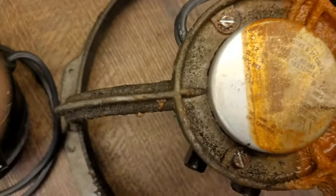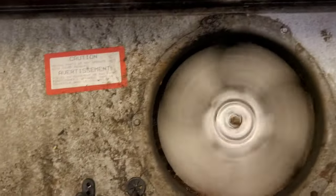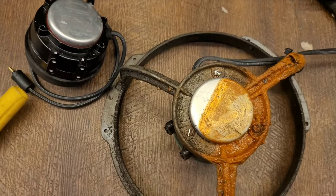So now we're waiting on the unit to cool down. I've got a bad motor — this motor is clockwise. See? Clockwise. And these right here, these blades — because that blade is just like these ones — they need to turn counterclockwise. So changing up the motor for the proper one, and that's probably what led to it failing — this improper airflow.